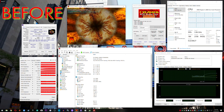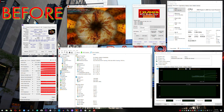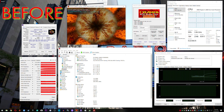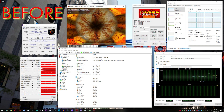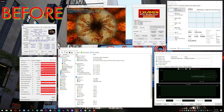I'll include some benchmarks so you can see a comparison when I was running AIDA64 stress test plus FurMark benchmarking the GPU. What I've definitely found as a huge benefit when gaming is that I'm actually able to reach the full clock speed of the GPU, which is 1340 megahertz, during gaming and during long sessions, and it never thermal throttles.